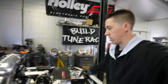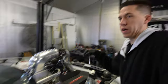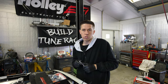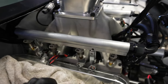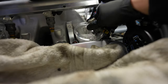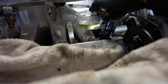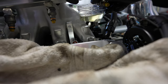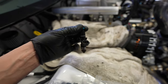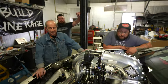Looking at the setup, the way the fuel lines are run I should just be able to pull the bolts, pick the line up, swap injectors and put them back down. Since I already checked all the lines for leaks I shouldn't need to do that again since everything will stay tightened down. Fuel rail is loosened up, got a pan to catch the fluid. These are a stubby-style injector with a billet cap on top but otherwise they're like a stock LS1 height, so they go right in. Injectors are all on, tightened down, everything's good.